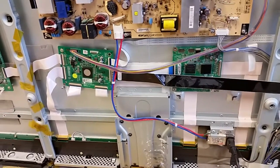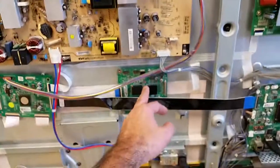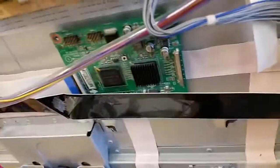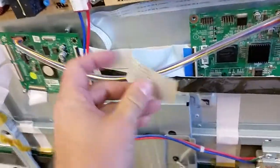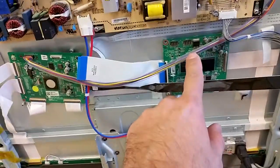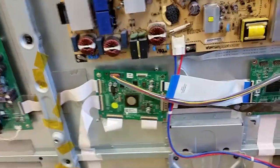There is a much simpler solution. This is a seven or eight year old TV — the panel says 2010. The simple solution is to just bypass that accelerator. As you can see, there is nothing connected here — it is being bypassed. This is the output of the video accelerator which normally goes to the plasma logic boards. Instead, you bypass both the plasma logic and the video accelerator and replace them with plasma logic boards from the other model, the 60PK750.